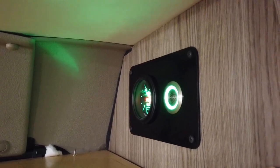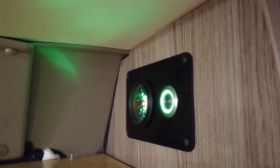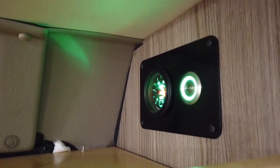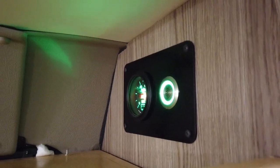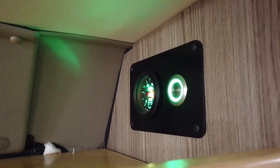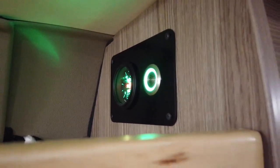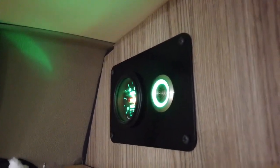So you got to drive or get in the sun or crank the heat or however you need to get that battery pack warmed back up to a temperature where your gauge turns back to green or whatever color, not blue, and then you'll be good to go again. So, like I said, I've blue gauged her a couple times, and no big deal. So yeah, that's it. Keeping her in covered storage is, of course, always preferable. I'm lucky that I have that ability.